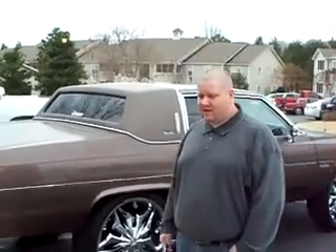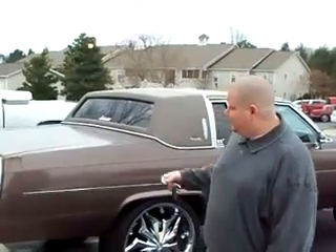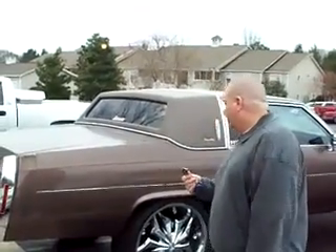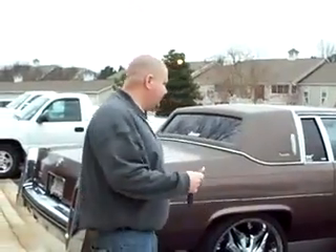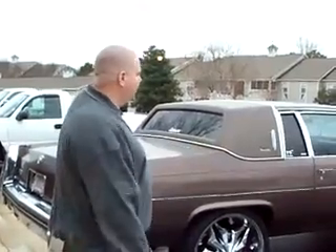What I'm going to do here is give you guys a brief demonstration of how my particular Viper alarm works. My Viper has the motion sensor on it, which picks up any high-density object around it, like a person. It'll keep warning the object to get out of the field that the motion sensor puts around the car until the person or object is out of that field. You can set the field to different distances from the car — I have mine generally set around two feet from the car.